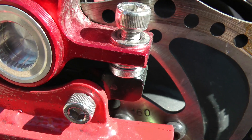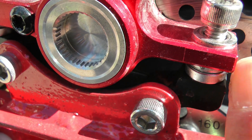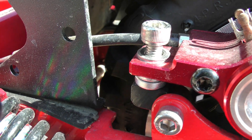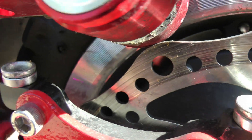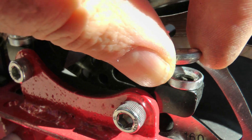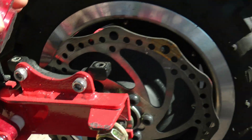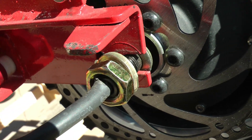So for both screws on the caliper of this scooter, there's the screw on top — flat washer goes through the caliper through two spacers and then screws into that black piece. I've pulled the screws out and pulled the caliper off. Just look at those two spacers — the thicker piece goes on the bottom and they're kind of rounded. The top part is kind of rounded so it bevels in, and the bottom part is kind of like a bowl that it sits down into. So the caliper's off. I've taken my hardware and set it aside where I'm not going to lose it. I've got plenty of slack in my motor wire, so now I'm just going to simply pull the rear wheel back and out of the forks.